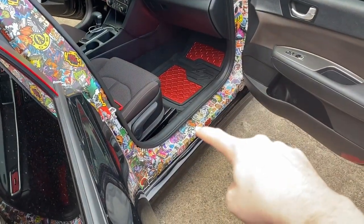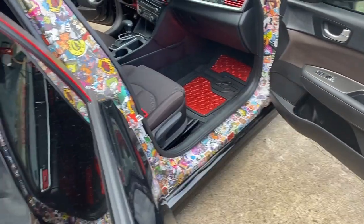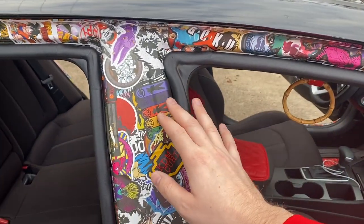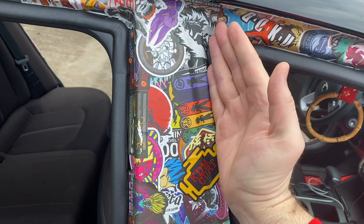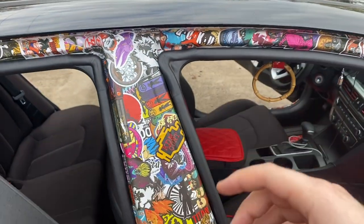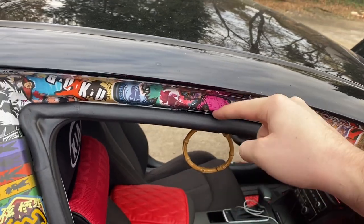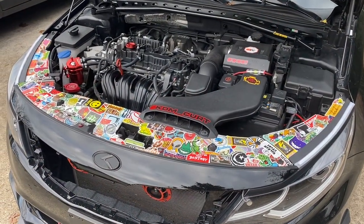I went ahead and took the little scuff plates at the bottom out — those just kind of pry up, they're clipped in at the bottom — and I did the whole thing because it didn't really look right with that sitting in the middle with no stickers there. Some quick tips if you're planning on doing this: for areas with a weird shape, put the decal down on one side and roll it over to the contour of the car. Don't try to stick it straight on or you'll get bubbles and creases. Also don't be afraid to cut some of these — I used my razor blade to slice a bit off some stickers so they'd go back in under the trim piece.